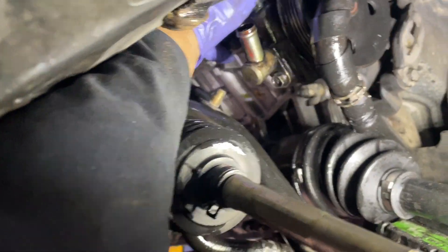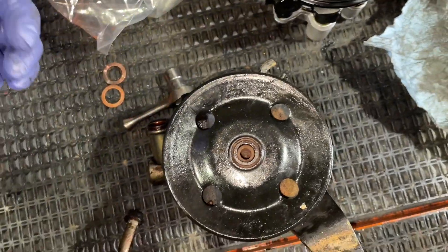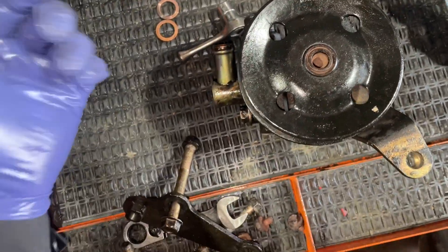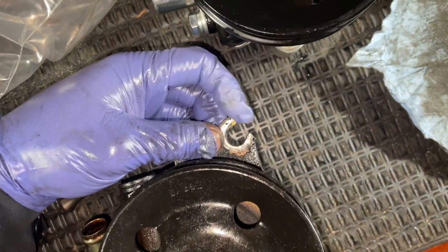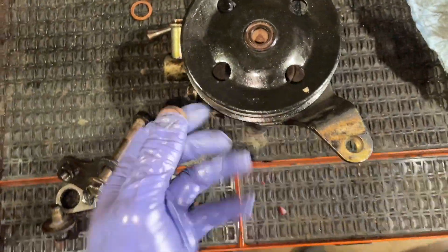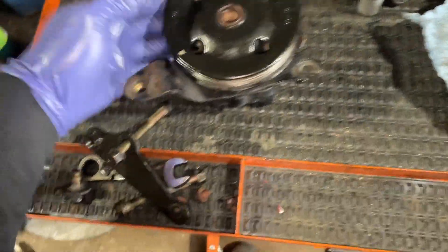So let's go ahead and remove the whole top bolt and get this whole thing out. I got it out — and now looking at it, I think on the last one I did, someone had rigged something up because I had issues. This OEM pump has a little slot so you can get the bolt in and out easily. Anyway, let's transfer these brackets — there's one 14 millimeter bolt on this end to transfer over.